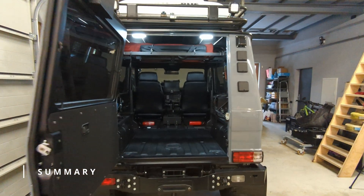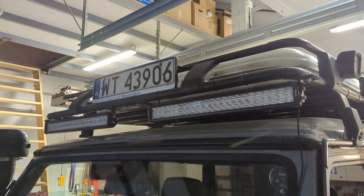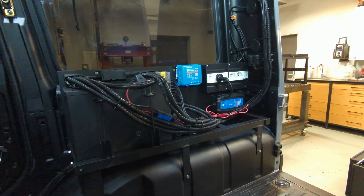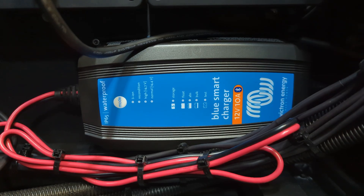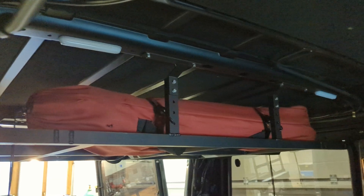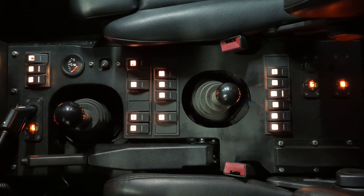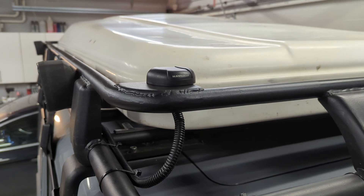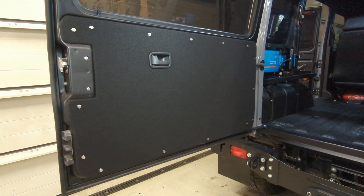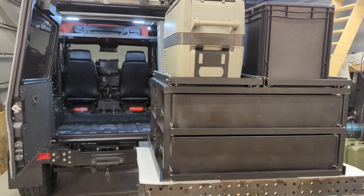I have installed everything and all additional electrics are wired as well. I have all front and side lights working. I have wired my intelligent battery system, additional hotel battery, DC fuses, AC-DC charger, external AC sockets, four additional interior LED lamps, rear camera, all rocker switches in my central console, and a new external USB GPS wired to my navigation system. I have also fabricated a covering panel with carpet for the tailgate. In the next video I will continue and build the main module with drawers.